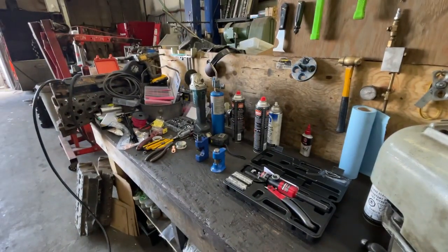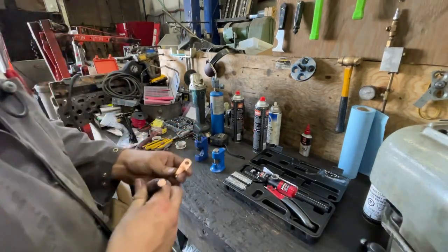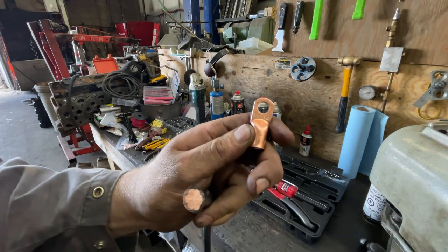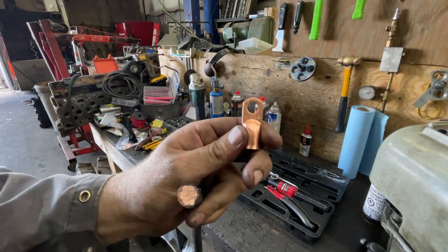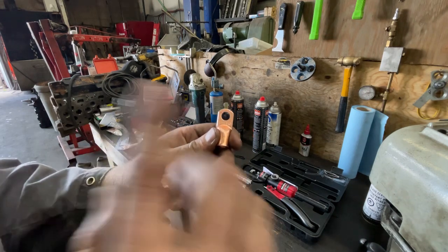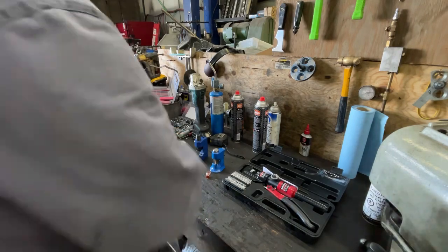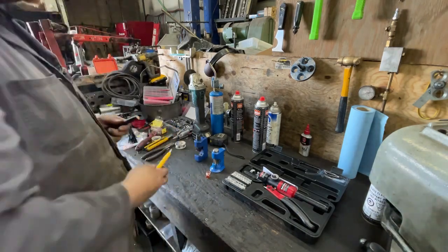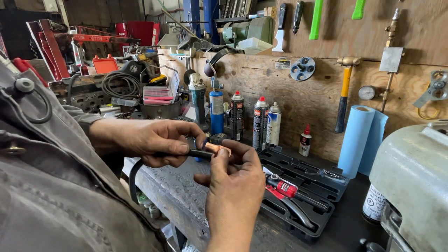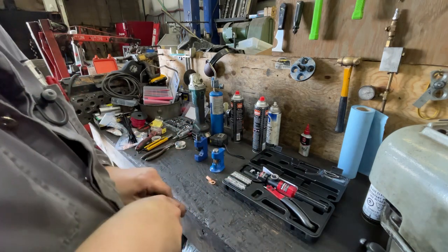So let's get after it. I've got the cable here — this cable is one-ought gauge. Maybe I'll do another video later talking about wire sizes and amperages and all that stuff; let me know in the comments if you'd be interested. Take an olfa knife, razor, whatever — that's just what I use. You're going to cut the insulation, and I cut it just a little bit longer — about an eighth of an inch longer than the lug barrel — and I'll show you the reason for that.